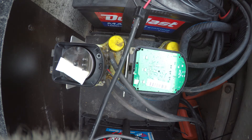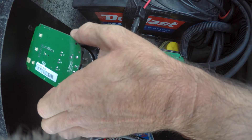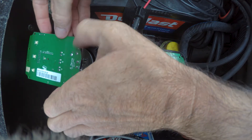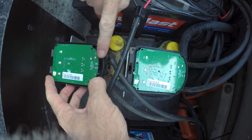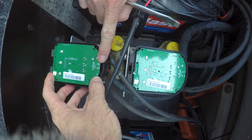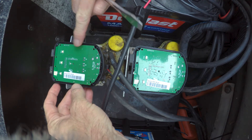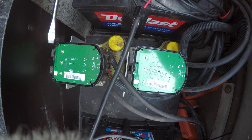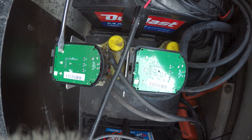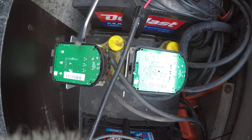To further confirm, I'll put this one in here and double check. Power off. There we go, that's in. Power on. Nothing. This motherboard is fried. That board is bad.